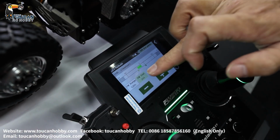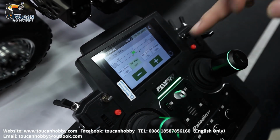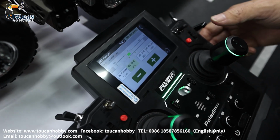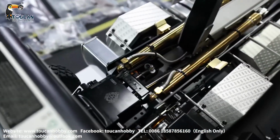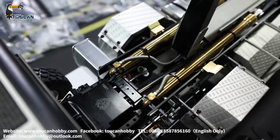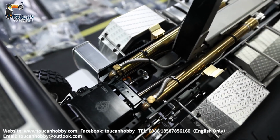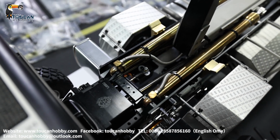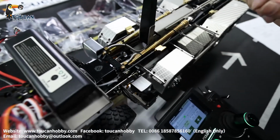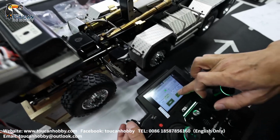Now if the switch is at the high speed side, you cannot choose this one. You need to change to the low speed side, to reduce the range on the low speed side. At the beginning the servo turning is very low, so you can try. Now it is low speed, check whether it engages or not. Also check from neutral position to low speed position whether it is still pushing or the servo is stuck; you can see its movement. There is no stuck, so we can still increase. To be sure it engages, all the gears engage, not only biting a little, increase the low speed side to 30. Let's see here.